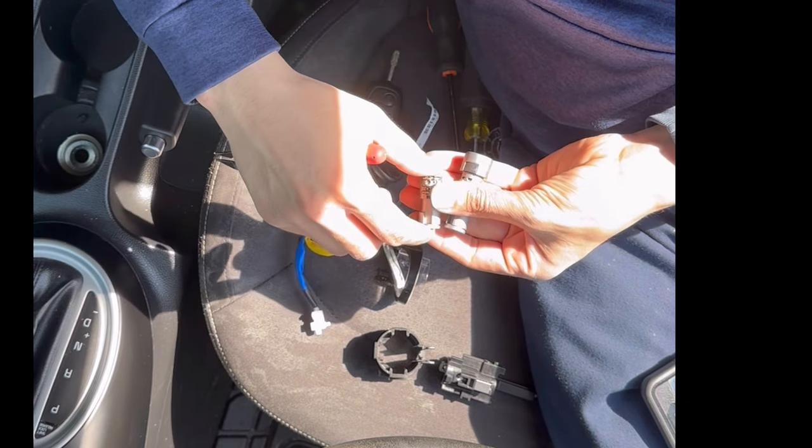Now we're going to have two extras on the new one since we were missing them from the old one, but I think it should be okay to remove them — it's not a big security concern, especially given that someone trying to steal this car with a screwdriver isn't going to be stopped by two extra wafers. Let's test it out. That looks pretty good except for this one here, which is the one we were missing. I'll go ahead and remove it along with the spring.